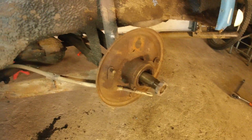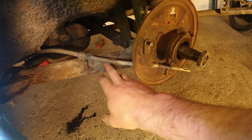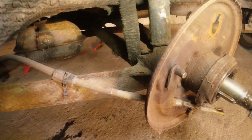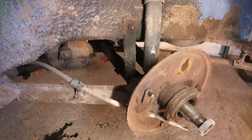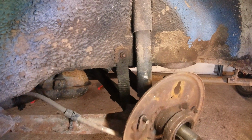Right now, with the car up in the air, the amount of travel downwards for the, is it called a wishbone? I'm not sure about that. But the amount of travel going downwards because of the spring pressing down is limited by this strap that goes around the axle and up. So this makes sure that the entire assembly doesn't just come apart, or that the suspension strut is not holding the force of the spring, because it's not designed for that.